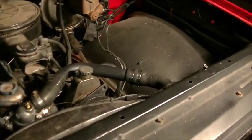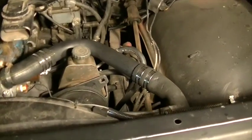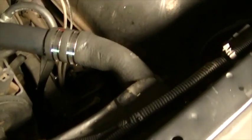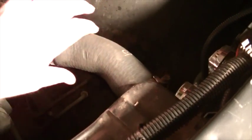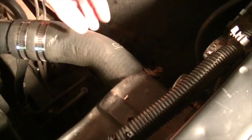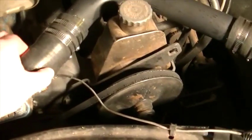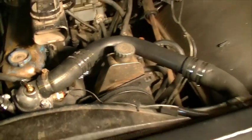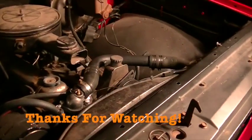So that's it for this little project. I haven't found any leaks, even at operating temperature. I'm pretty sure there's no air in the system — I've got to do this quick because it's hot — but this hose is still squishy. When there's air in the system and it gets hot, it will balloon out and be like an inflated tire — it will be hard to pinch. I don't notice that anywhere on those rubber tubes, so I call this a success.